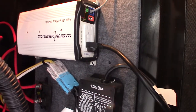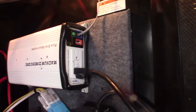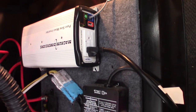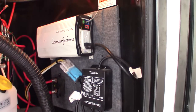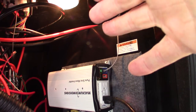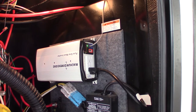The hydraulics are here. This is a kill switch to disconnect the battery. This is an inverter — it takes 12-volt DC from the battery and converts it to 110 AC, then sends it to your refrigerator. Because you have a regular AC-type refrigerator inside, the same type you'd have in a kitchen, you can run down the road and still keep the refrigerator going so nothing spoils. When towing, your tow vehicle's alternator charges the battery, which sends 12 volts to the inverter, which inverts it to 110 AC for the refrigerator. This also converts power in the opposite direction — AC to DC — I'll show you that when we get inside.